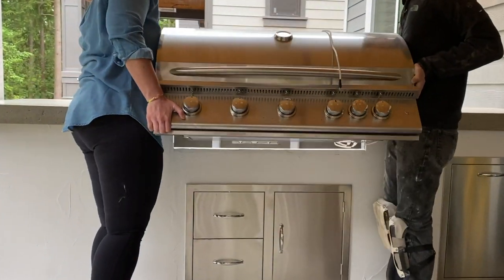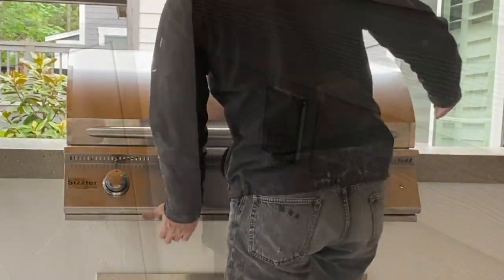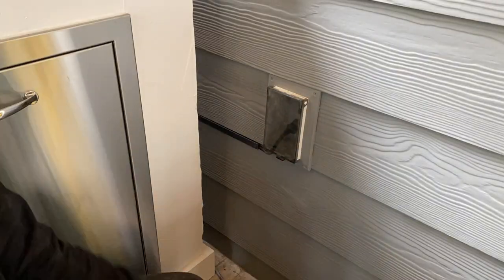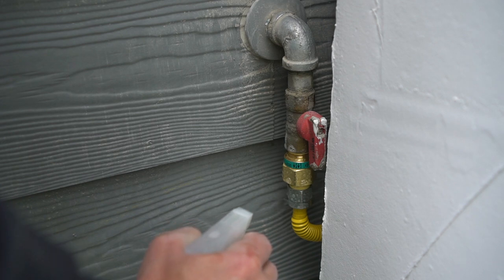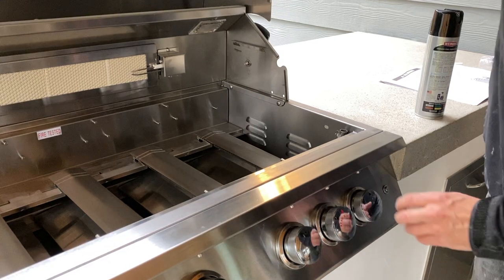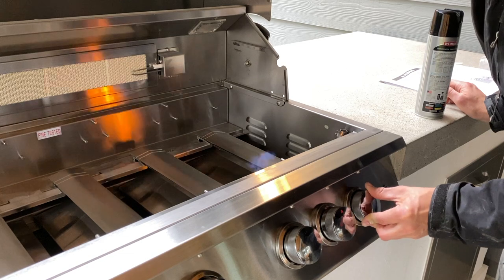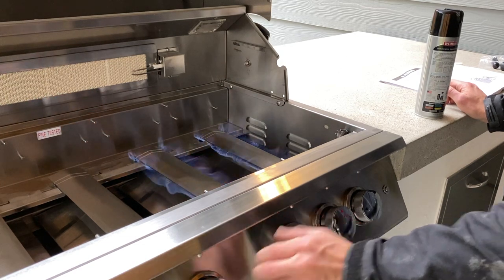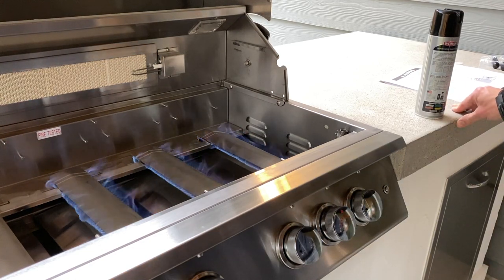Hopefully you have a helpful hand to lift this large barbecue into position, set it down, connect the piping in the back, and connect your electrical requirements, then turn on the gas. A quick but critical step: take some soapy water and spray your fittings down to check for leaks. If there are leaks, you'll see small bubbles at the surface — turn off the gas and tighten your fittings a little more. Once confirmed, make sure every single burner is working properly, and then you're done.